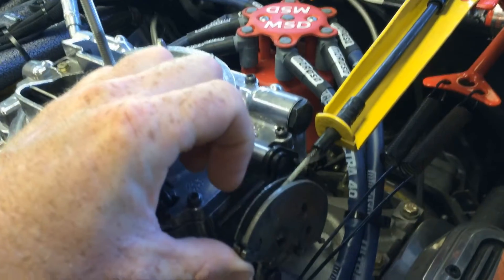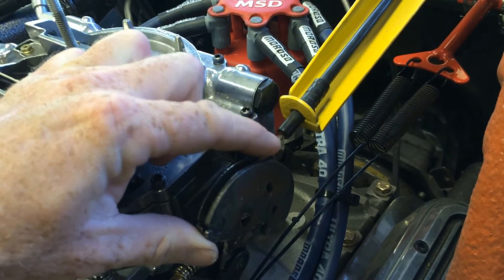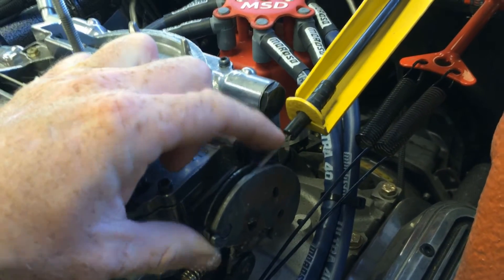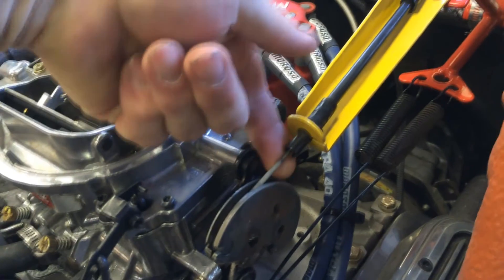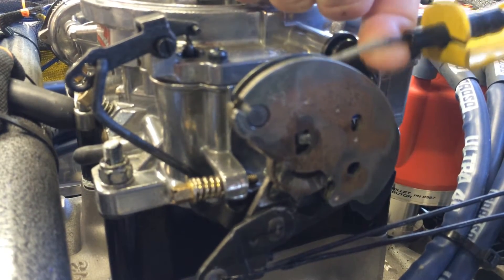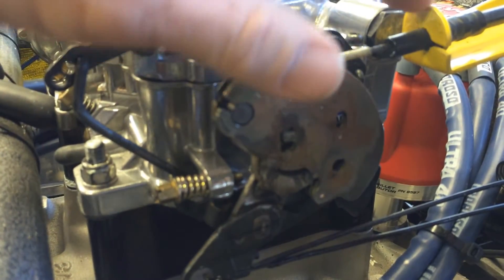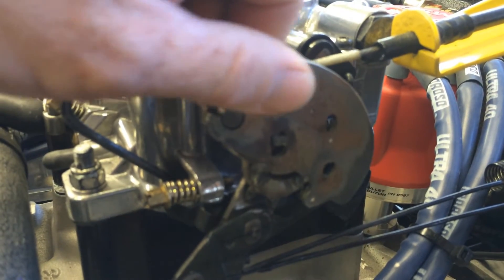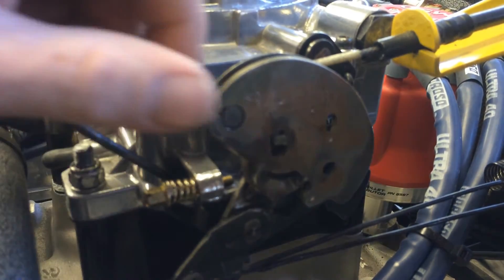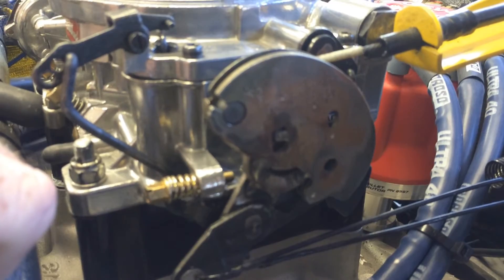By pushing on the cable we can check to see if it's got full tension or if there's a little bit of slack. You can see the throttle roll just a little tiny bit — I've got a little bit of deflection there. I do get some deflection out of the bracket I've built up here, but that's normal and that's what you want. You don't want it to be pulling real tight because you'll bend all your linkage. Your foot is stronger than the carburetor.